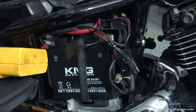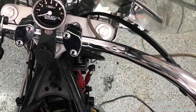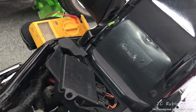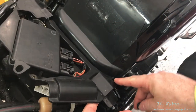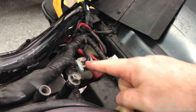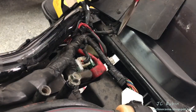Generally, if the battery has enough juice to crank and start the bike, it has enough to run the ignition. Turn on the key — lights come on, you can beep the horn — your main fuse is good. But if everything is completely dead, we need to look at the main fuse specifically. Pull the two plastic clips from the cover under the seat, lift it up including the flap in the back, and we can see two 30-amp fuses — one spare, one live.